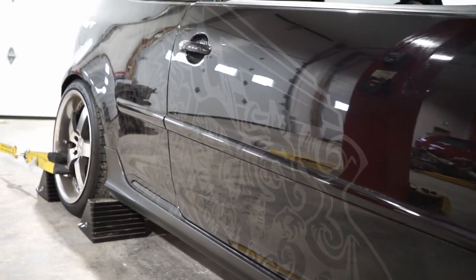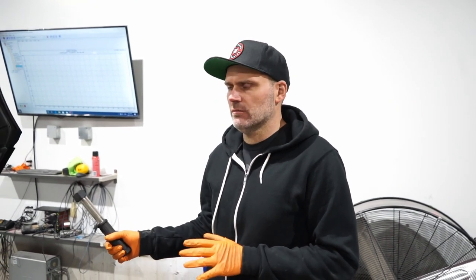It's completely standalone. So we've kind of hit the limit of what this is going to do with the APR tune, and the next rendition — once we get the all-wheel drive done — this guy wants to really step up the horsepower game. We'll be abandoning the APR software most likely in that case because it's going to be a really custom setup. But the first thing is we want to dyno it and see what it's making for power before we switch over to the all-wheel drive setup. Power numbers — I won't talk on where we're going to head for power numbers yet. This first part of the project is to get the all-wheel drive done. Do you have an idea of where it's sitting for power now? Yeah, I think the highest it dynoed when we were pushing it a little bit was around the 450 wheel horsepower mark. I'm not going to touch the boost controller or anything — I'm just going to run it the way it is. It should make around 400 horsepower I think today.